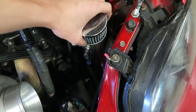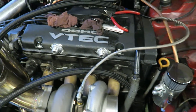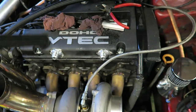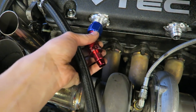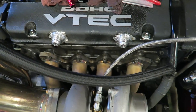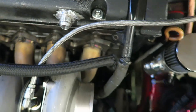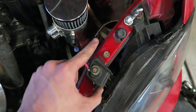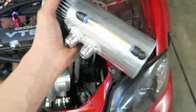I'm thinking about putting it right in this little corner — it'll be nice and out of the way, and the hood will still shut just fine. I already went ahead and ordered two dash-10 90-degree AN fittings for my valve cover, because the 45s I have don't have enough angle. I need 90s to get them more pointing that way. So I've got two 90s coming, then I'll just run the hose from those 90s right under through here and right into the catch can. They'll be nice and away from the manifold, shouldn't get too hot. I'm just gonna make a little tab that comes off this nut right there, 90 degrees down, and weld this to that tab, and the catch can will be mounted.